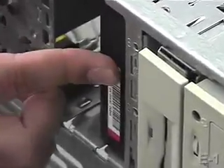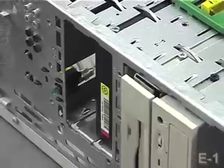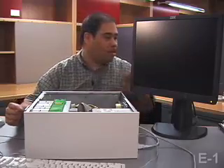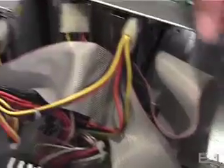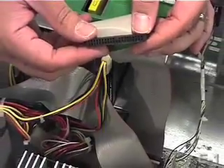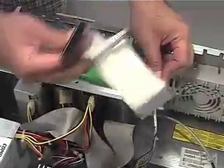This model is going to be a little bit different from other models. In other videos, we showed you the anatomy of a PC with an IBM, but in spirit they're all pretty much the same. So as you can see from this angle, our hard drive is right here — connected with this IDE ribbon in the back and with the power cord right here. Unfortunately, this particular IDE ribbon has only one connector and can only support one hard drive, so sometimes you need to get a replacement IDE ribbon that has two connectors to support multiple hard drives.